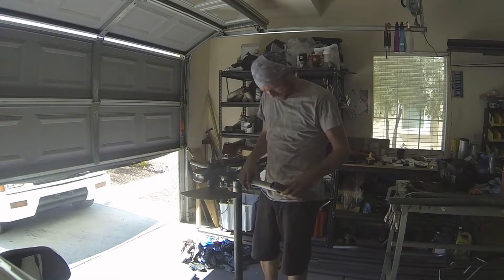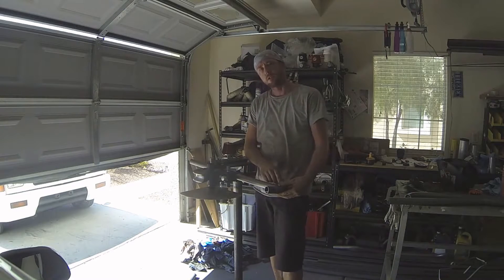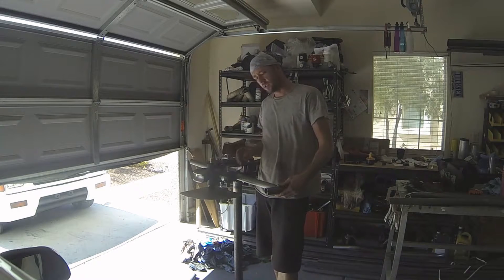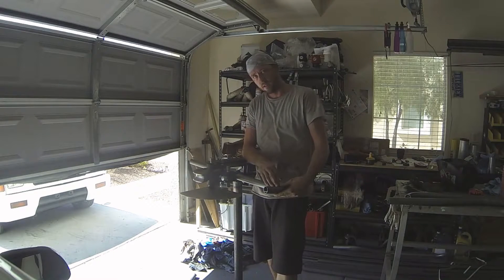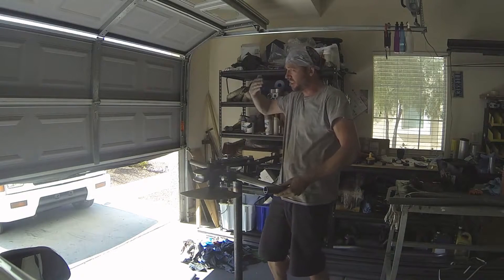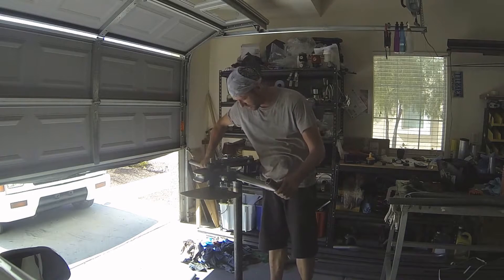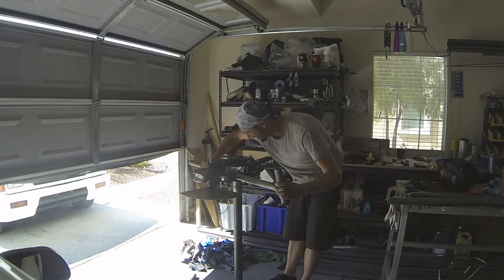Okay, we're all set up in the bender. I'll take a spare piece of tube and place it in the notch to kind of see where I'm at. The reason I do this is so I can figure out which direction I want my bend to go. With the way I have it set up in the bender, the bend is actually going to go forward — but I don't want it to go forward. I want it to go upward, bend around the mirror, and point up toward the roof line a little bit. So I'm just going to clock this at right about where I think it's going to end up.